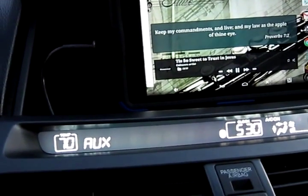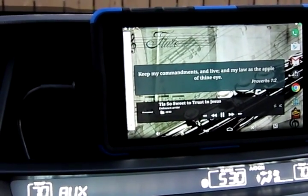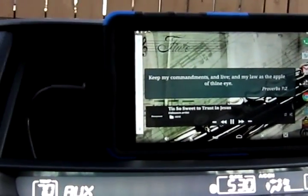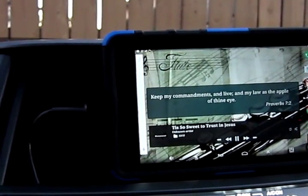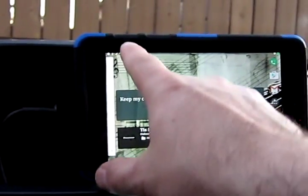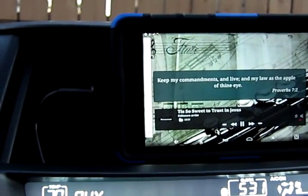I'm definitely a lot more pleased with this setup. One of the big benefits is that this setup will be upgradable because the tablet is easily removed. I did this previously in my Acura TL and that setup was not upgradable due to size constraints. With this setup I have a very large space — I could even fit the Nexus 9 there, provided I get a Lollipop kernel on the Nexus 9 that allows charging while in USB host mode. There's really no need for Power Event Manager — you can do everything it does from Tasker with a rooted tablet.